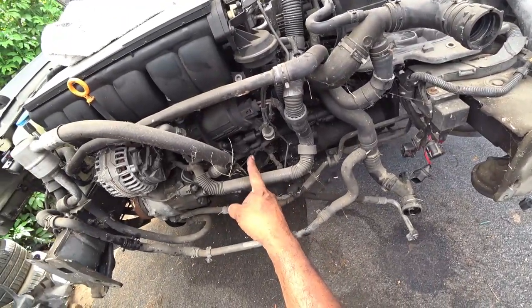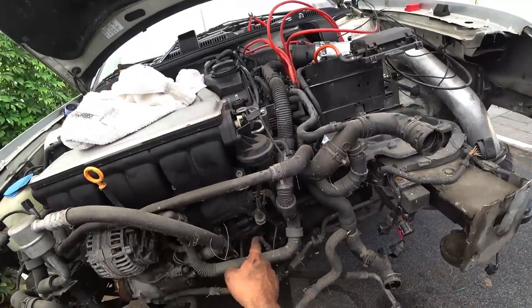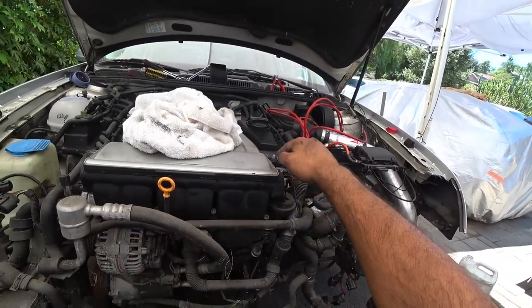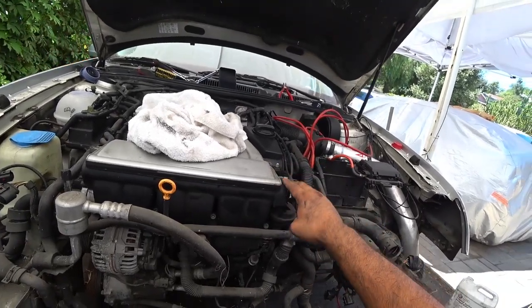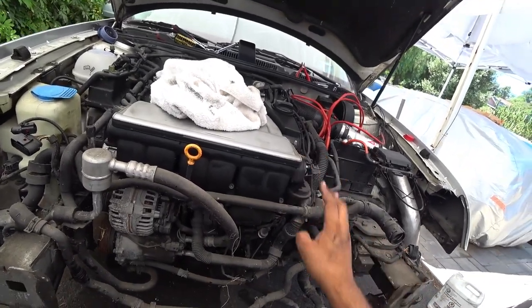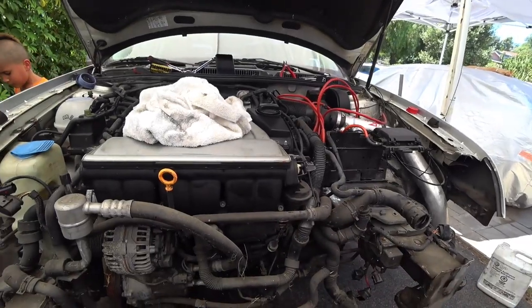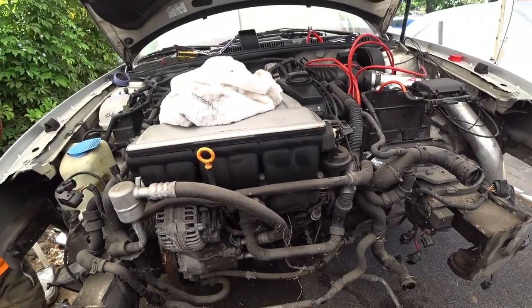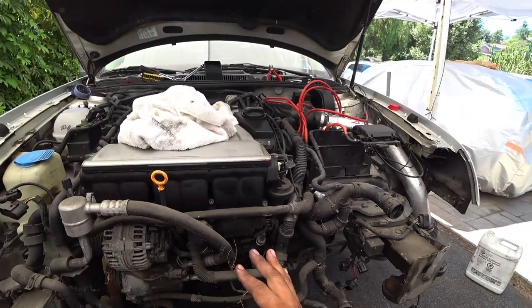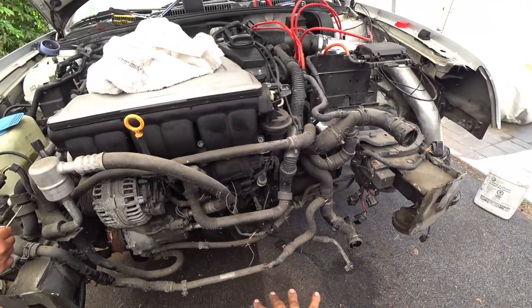Your vacuum system for that. Right here is an idle valve — this valve is actually a throttle plate valve. This is vacuum actuated. These are notorious for failing or for flapping really bad over the years. What this does is when you're at an idle, this cuts the amount of air going into the engine to create more lower-end torque for you. Once you open it, it pretty much opens up the whole engine and gives you full power.